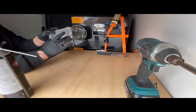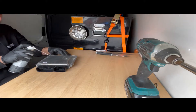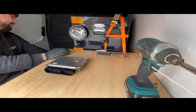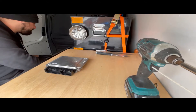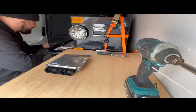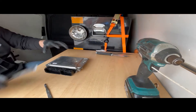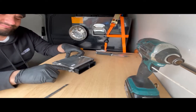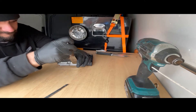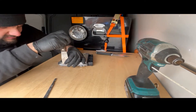Always going to start from the other end to the heat pad. So first things first, we're going to work around this edge here and we're going to lift up and just cut away at the same time — little by little once you get the blade in there. Sometimes it does pop off. It's a bit tighter than usual.